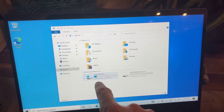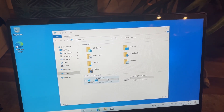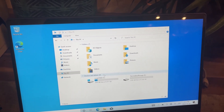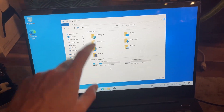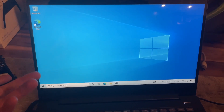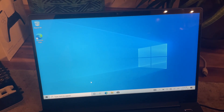The system is booted up with Windows installed on the new drive - the 2280 NVMe. That secondary slot accepts up to two terabytes. I wouldn't get a large 2242 drive since they get pricey, but the 20-something dollar option I found is perfect. Really happy with this laptop overall - it has a touchscreen 1080p display that's really bright, two NVMe slots in a 14-inch laptop which is kind of crazy, a great keyboard and trackpad, and it's still an 8th gen i7 which is more than capable.